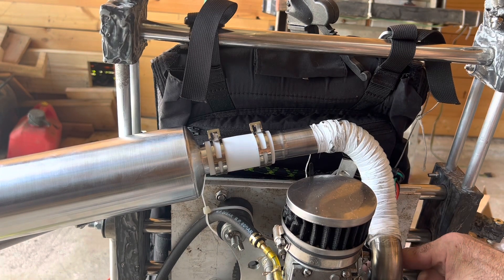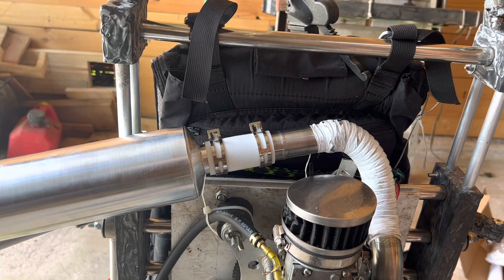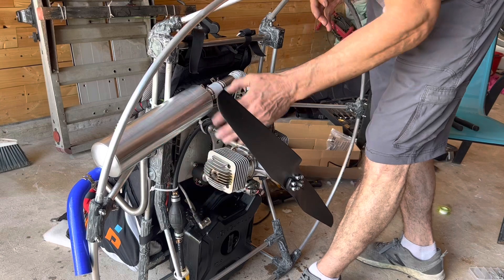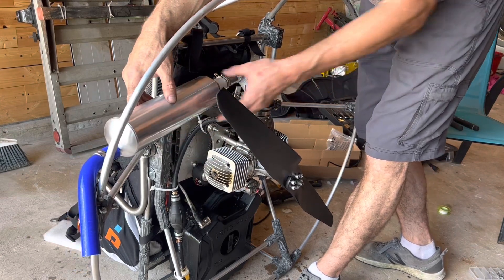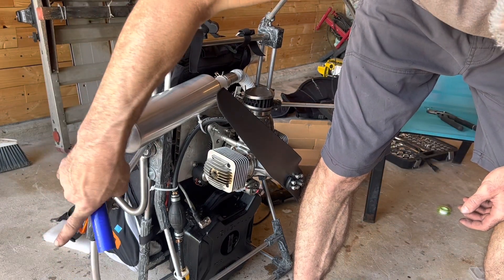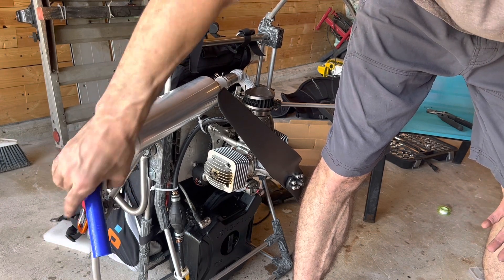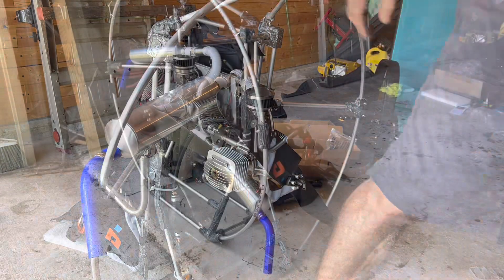You don't want to put any stress on the bolts down here, and it's difficult to bend, so I had to put it in my vise. I kind of wanted to roll it around and have it go down, but I don't want it anywhere near the gas tank. This will keep it up and away from the gas tank and allow me to mount it to the frame. I'm going to mount this to that hoop section — it's not really going to provide much support but it'll keep this from flopping around. One more attachment point won't hurt; I'll probably just put a tie-down in there since it won't be very hot at that point.